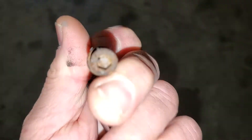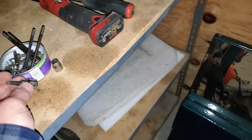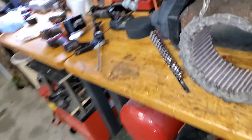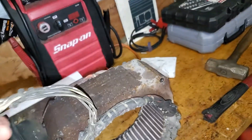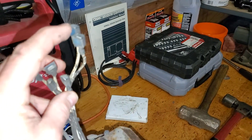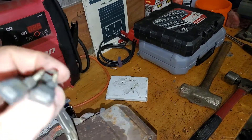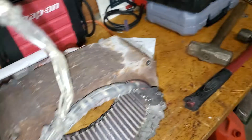Make sure you clean the hole out right there where the five millimeter goes down in. I've got my cat food cans that I keep parts in — there's a 10 millimeter. Now we'll go over and show you the stator. It's a three-phase stator. I'm showing you the groups of wires — see how they're like short, middle, long, or longer? That's why they go in a certain way.